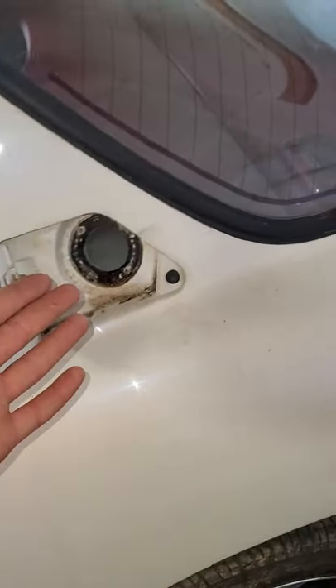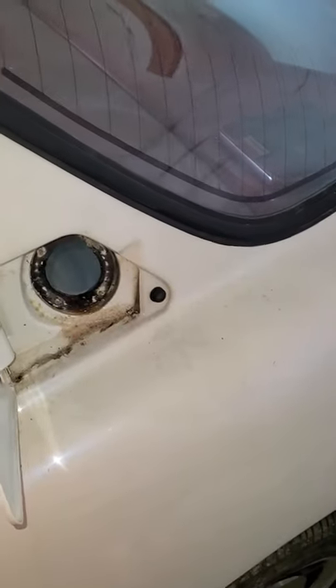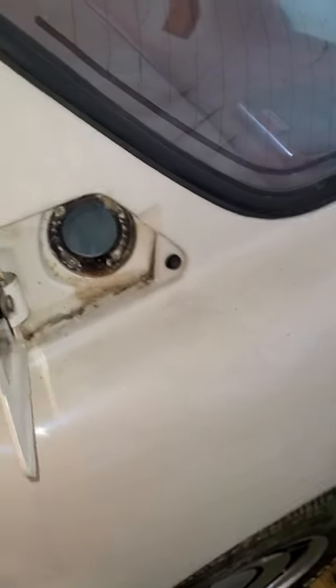This is the gas I took out of the tank. Whatever your fuel level is, you want to siphon most of it out through here, so that later when you remove the bottom fitting, you won't lose a bunch of fuel on the ground. Then head back inside the car.